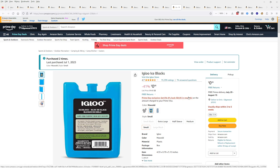Ooh, there it goes. Now we're getting into the non-3D printing deals. These are actually wonderful. I cannot believe they're still available. These are 98 cents a pop. If you have one of those electric compressor-driven coolers like I have, not the Peltier ones, not the thermoelectric ones, but the ones that actually have a compressor in it, and they can run off AC or 12 volts, I'm actually working on converting one to run off USB-C, which should work, because in eco mode, they only consume 30 or 40 watts, which is within the specifications for USB-C PD at 15 or 20 volts.